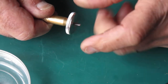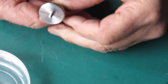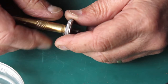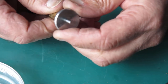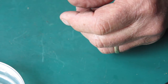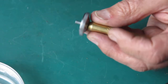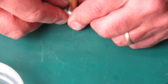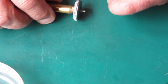I'm just separating these pieces to put some in the ultrasonic cleaner. I think I noted that the rewind appeared to be bent. This should screw straight in here but it's very reluctant to move, and the thread is stripped at the top — so bad things have happened to that screw. I'm holding it up to the light to see if it looks out of square — it doesn't really. I think someone's over-tightened it and stripped the thread at the top. What I'll have to do is load this up on a block, pressing hard on the underside, and then unscrew it from the top so that thread engages and winds out.